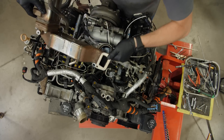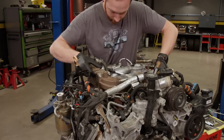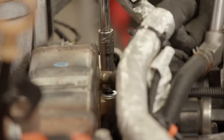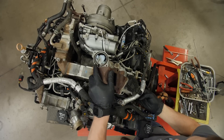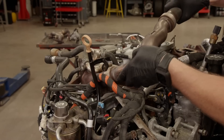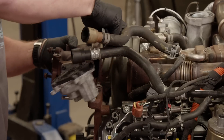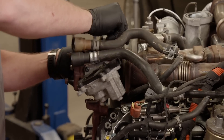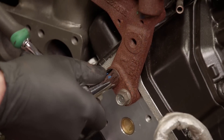There are several smaller pieces that make up the EGR system, and I'll start with the main lengths of the EGR cooler, then attach the forward EGR valve between the cooler and the intake, and then connect the secondary tube to the top of the valve. On the backside of the engine, the primary valve connects everything together, and again, this work is so much simpler to do with the engine not in the truck.